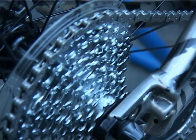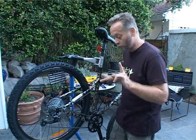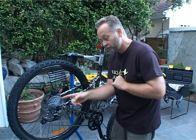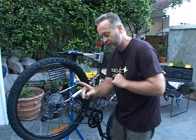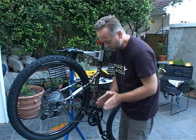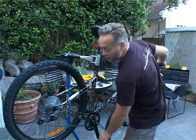Now let's briefly look at how to use the gears — what combinations to use to get the best results. As a rule of thumb, avoid the following combinations: if you're in the small one in the front, avoid using the two small ones at the back. The same goes the other way — if you're in the big one in the front, avoid using the big ones at the back. When in the middle blade in front, don't use the top or bottom gear at the back. The reason is that these combinations cause the chain to cross, making noise and increasing wear.